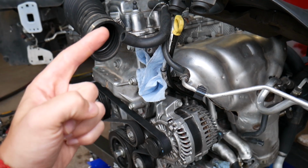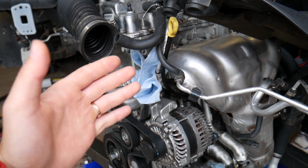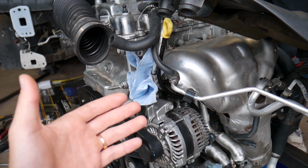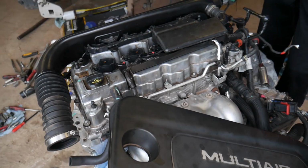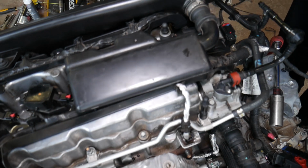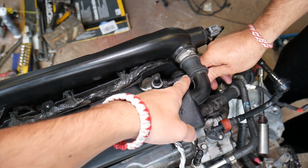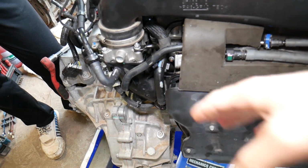So that's one thing. Second, the gas that makes its way into the crankcase is super harmful for the engine. It can corrode things and wears the parts fast, so it needs to get out of the engine fast. How does that happen? Through the PCV valve. The PCV valve takes that gas, that pressure from the valve cover, to the intake manifold. From the intake manifold, it goes to the cylinders, burns one more time, and exits through the exhaust. So it's a very important component.